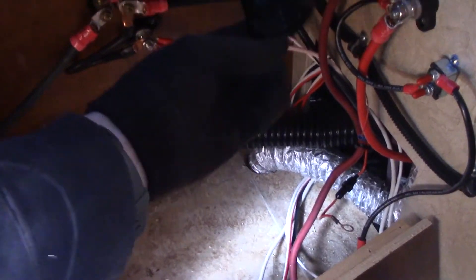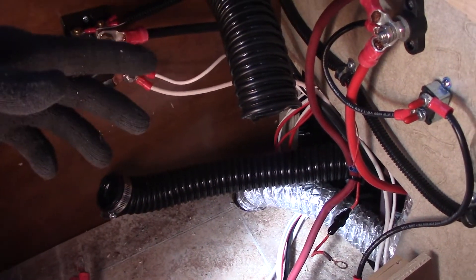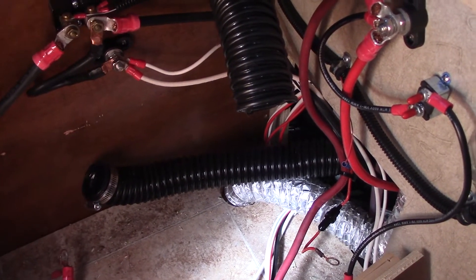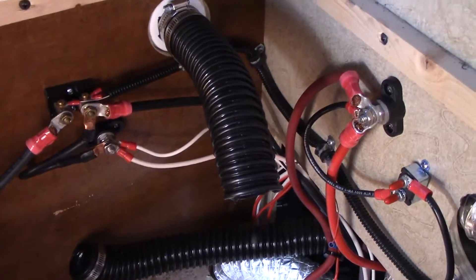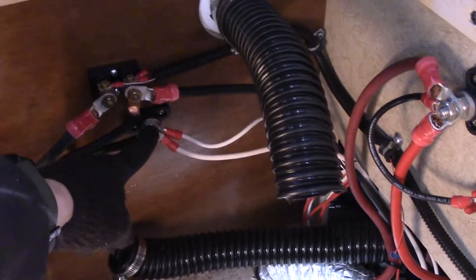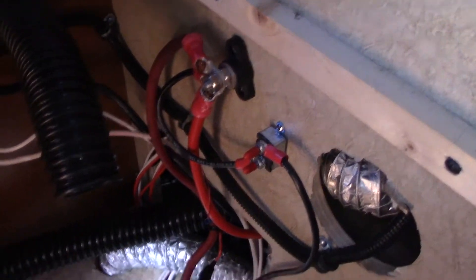The Lance camper has a vented battery compartment — there was a vent on the bottom and a vent on the top of the old compartment. That's to let out the gas that boils off from the acid, which is actually explosive and will set off your gas detector in the RV. Obviously it's not a good idea to have that floating around in here, so that's why they have the vents. We're going to utilize those factory vent locations. I had to move the negative terminal block up onto this wall and the positive terminal block up as well.